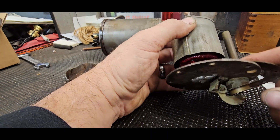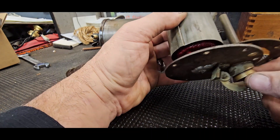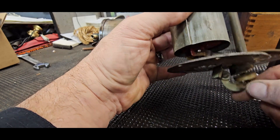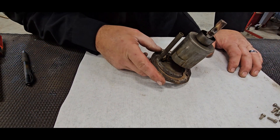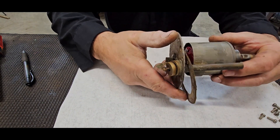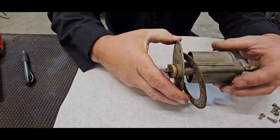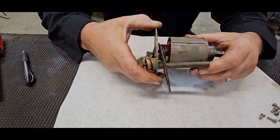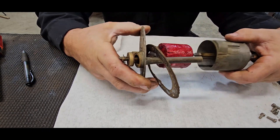I've got some fancy new material to make a cork out of. I'm also going to rebuild this gasket - this needs to be completely sealed. I'll clean it up with some carb cleaner. I want almost no friction on any of this. This is leaded in here - it's basically a nut leaded to the bottom of that. All I have to do is unscrew this and it should come apart. There we go.